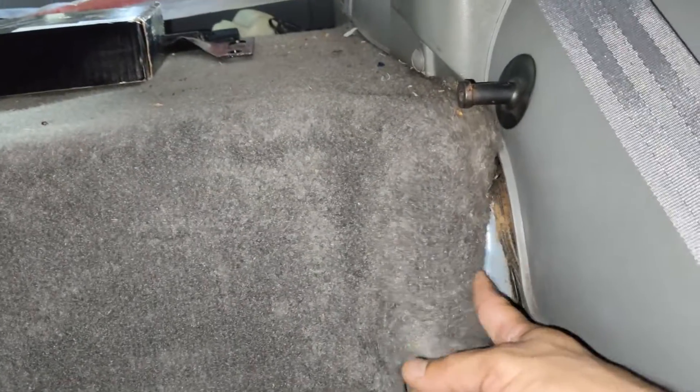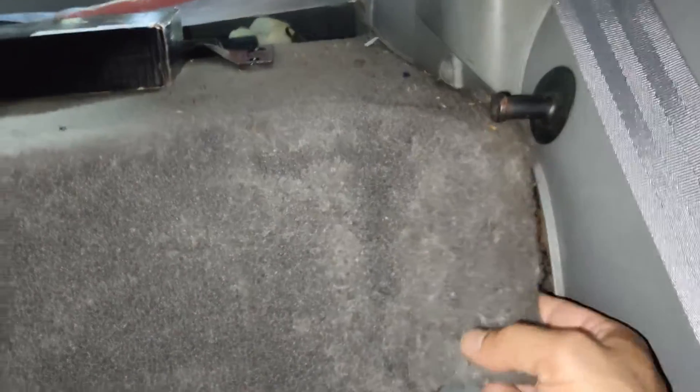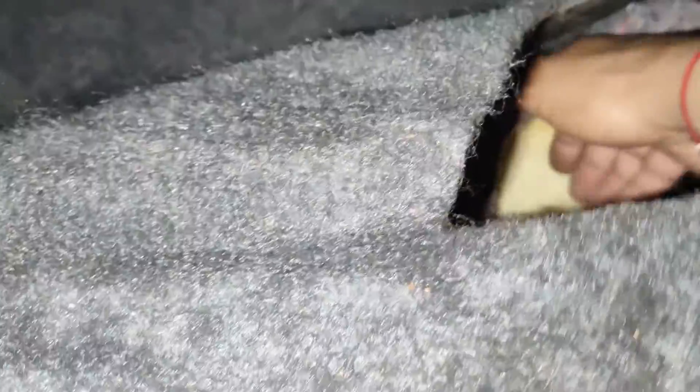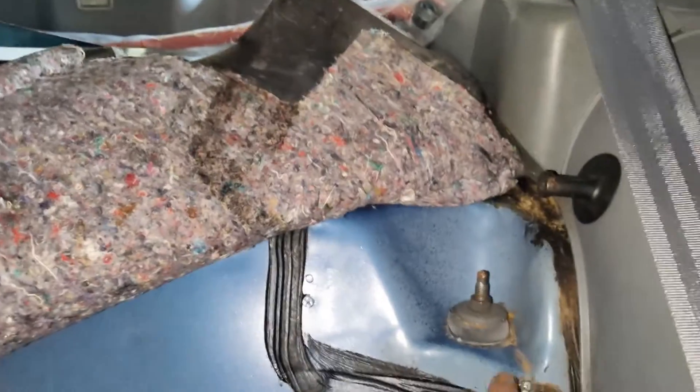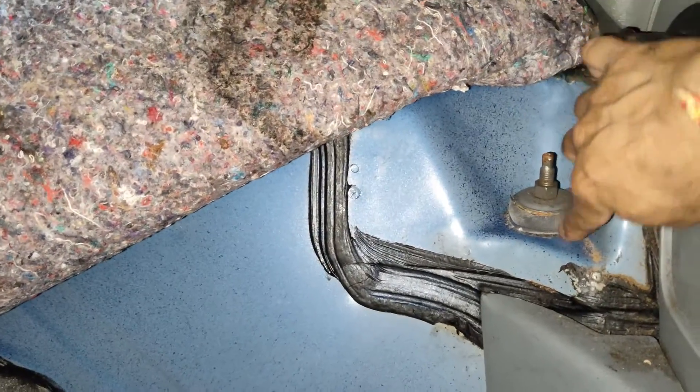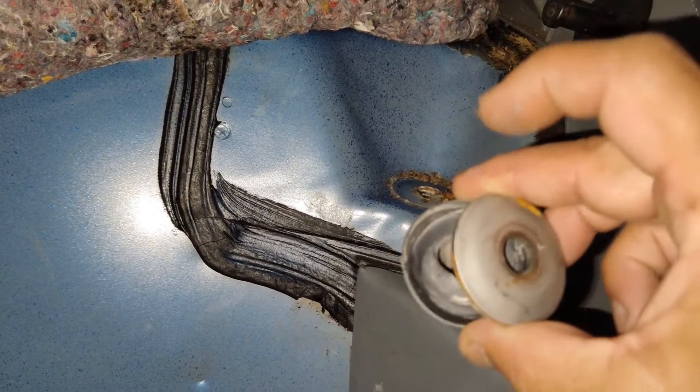The seat folds all the way down giving you access here. The upper mounts are right under here — they're not under any of the trim; you don't need to remove any trim. The piece of carpet in the back of the vehicle is a separate piece from the front. Take a screwdriver or some type of tool and pull it away from underneath the trim here. Once you do that, grab the bottom of it — there's padding underneath — and pull it away. There's a foam piece in the corner; once you remove that, there is your upper shock bolt. It's a 15 millimeter, with a rubber absorber on top and a washer and 15 millimeter nut.